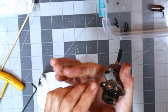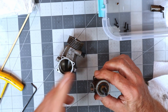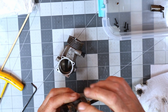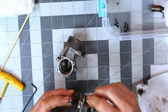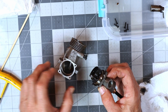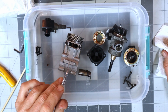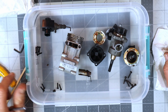The question now is I'm going to have to heat this thing up and either hold it in my hand or find a soft-jawed vise. The front housing is the main thing that needs to be cleaned or at least attempted to be cleaned. I don't even want to touch that gasket because it could be instrumental in setting the gap distance between the end of the crank pin and the back of the case. I found a pick and pulled out that little Teflon retainer pad, but that wasn't the piston pin sliding - and after seeing the top of the piston, that doesn't surprise me one bit.